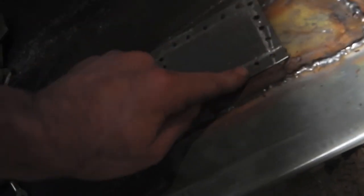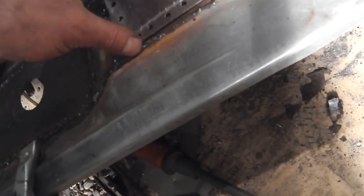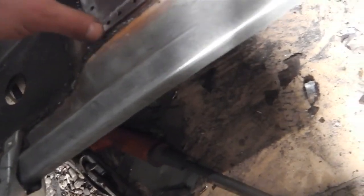We'll bolt that to the bottom of the seat with a nut already on it. Let the seat go down, then I'll get a couple of tacks on, then lift the seat off. That's the procedure. So we'll get the nut welded inside there. First I'll have to make a cut out there for the nut. Weld the nut on, position it on there, then weld it in position. That's the plan. Okay, we're going to do that now.